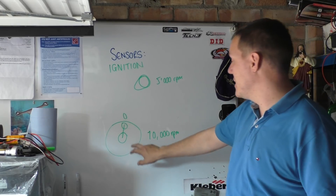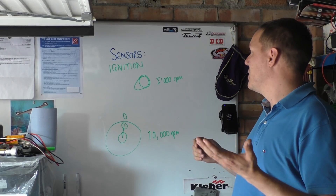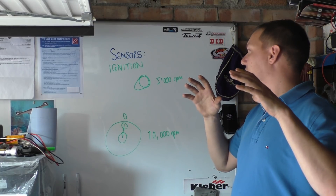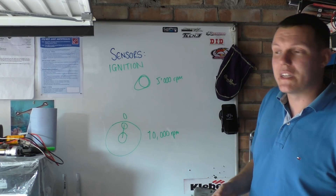That's the reason why cams can basically rotate in straight bored-out aluminium caps straight in the head. This is why they don't wear out anything like crankshafts do. Number two is they are under an oil film, just like your main bearings. Aluminium is actually quite a good bearing surface — it's quite a good bearing material unless it's put into too much load, which it would be at the crank and it's not at the cams. And not only that — you're going half rotational speed.